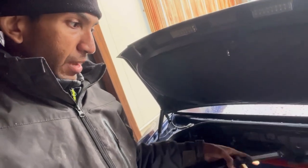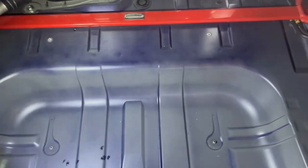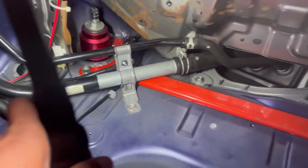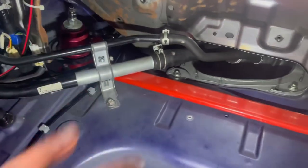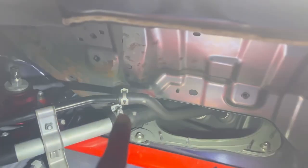There's plenty of room for sound to bounce around and resonate. The first step is to remove all of your trunk interior trim and lining — it's just a matter of removing a bunch of plastic rivets. You just need a pry tool or a flathead screwdriver, and some 10mm bolts to get the aluminum shielding piece off that sits between the fuel piping and the rest of the trunk.